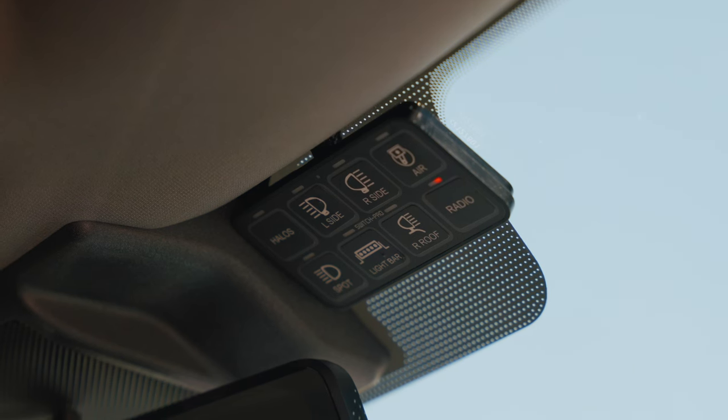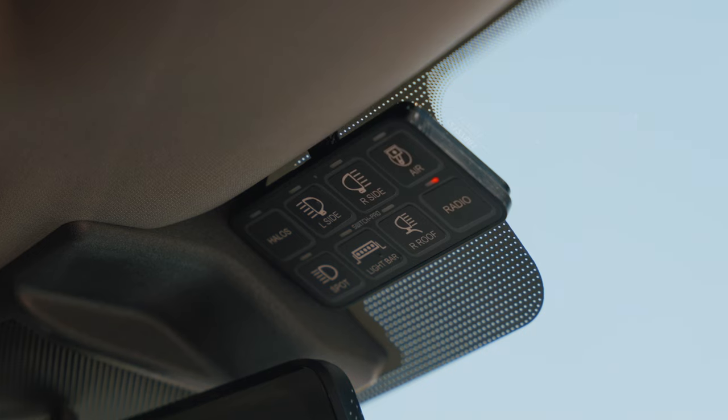The accessories on the roof rack are switched all through the Switch Pro. So we've upgraded the initial lighting that is on the front bar, as well as all 12 volt applications through the Switch Pro SP9100 switching unit. As we know from each of our videos, these are our favorite units for these American trucks. We've got the usability to change the work lights on the sides. They've got dimming features. This one, we've got 3 different levels of dimming in each of the work lights, being the left-hand side, right-hand side, as well as the rear of the roof rack on the back of the canopy, sorry. And you can get on your phone. You've got Bluetooth capabilities here.